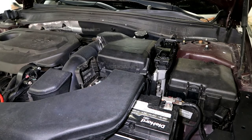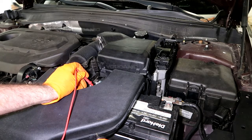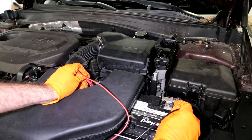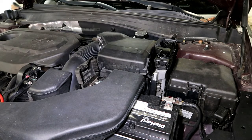Say you've gotten in your car, turned it, and it just does a click click noise — the first place to start is to look at your battery and check its voltage. With any standard voltmeter set to the DC setting, put the red lead on the positive terminal and the negative lead on the negative. You should be anywhere around 12 and a half volts — anything over 12 is where you'd want it. Anything below that and you potentially won't be able to start your vehicle.